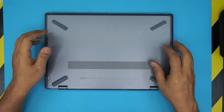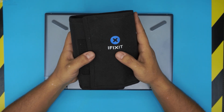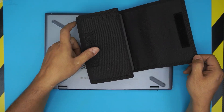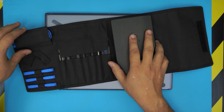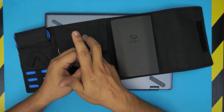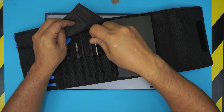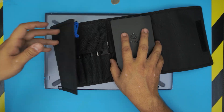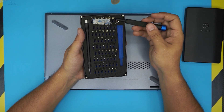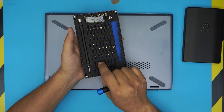Before we get started you need a few tools. The most important one is a screwdriver set and an opening tool. I recommend the iFixit full tool set — it comes with everything you need to open electronics, cell phones, and laptops. If you don't have the opening tool you can use a guitar pick, which works pretty much the same. The key bits you'll need are Phillips number zero and Phillips double zero.